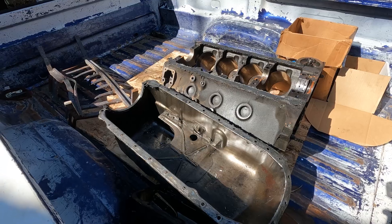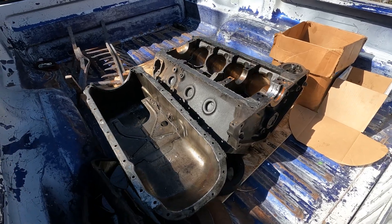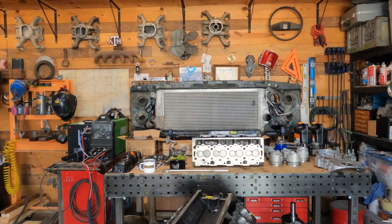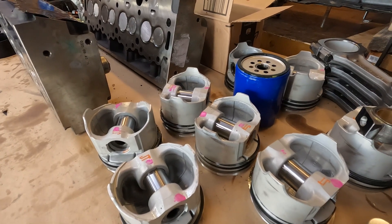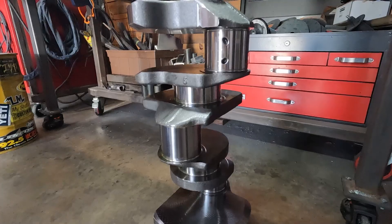Engine is out, it's all torn down. The block and all that stuff is going to the scrapper. We actually have the new 6.5 in and completely torn down, ready to get refreshed with some new parts. We're going to balance the rotating assembly, stud the bottom and top, go gapless on the second ring. Other parts and pieces — we'll cover that in another video. But yeah, building a new engine — didn't plan on doing it, didn't want to hack my truck up to do a Duramax or some other kind of swap. So we're going to do what we think is the best 6.5 we can put out there, really excited to get that thing together, throw a bunch of fuel and boost at it, and have some fun.